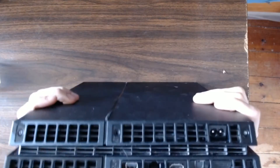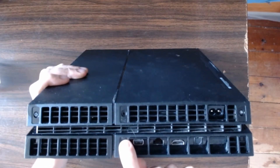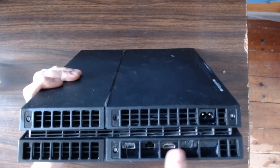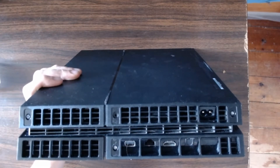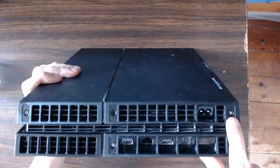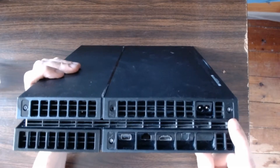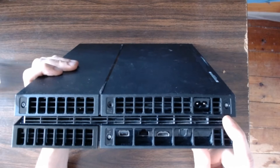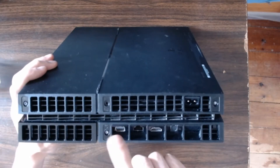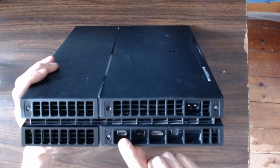Pick up your PS4 and on the back you'll see four places where there are screws. Go ahead and remove all four of those screws. Yours might be covered with a sticker that you'll need to remove with some tweezers or a knife to lift off. Once you do that, you'll be voiding your warranty — just a warning. But I doubt you care because you're probably already out of warranty by this point after having a PS4 for likely years. These screws are removed with the T9 Torx security screwdriver, as most screws in the PS4 will be.